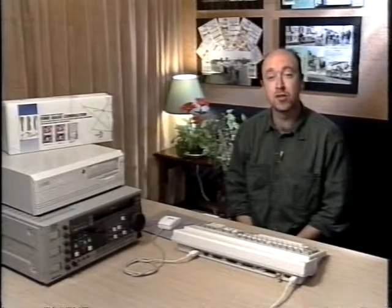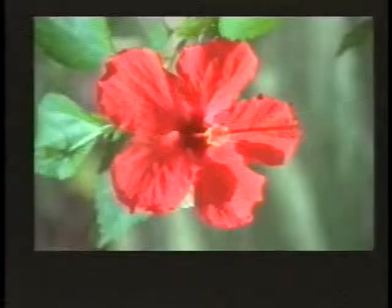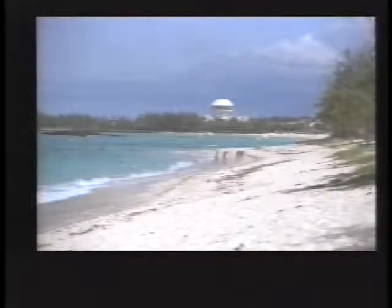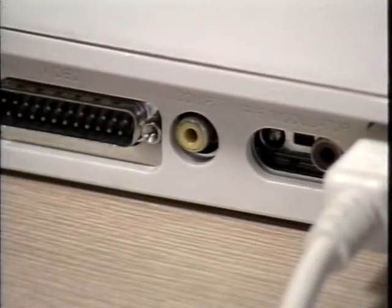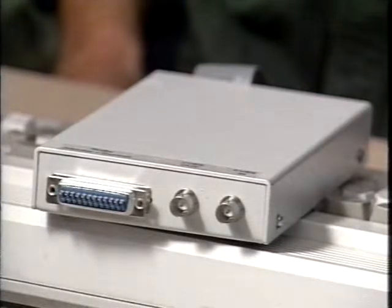Let's now look in more detail at the Amiga and specifically at video hardware. First, it's worth recapping which model of Amiga is the best investment. Your choice essentially is between the A1200 and the A4000. Both these machines feature the newer AGA chipset which gives you new screen modes, including extra high resolution modes and modes that give more colours. The HAM 8 mode means you can use up to 262,000 colours on screen, which for video purposes is more or less as good as true colour.